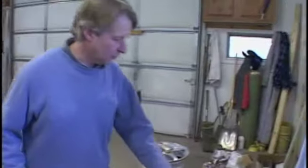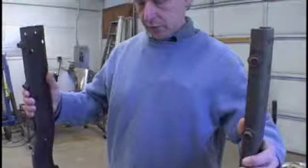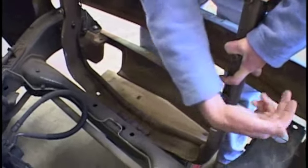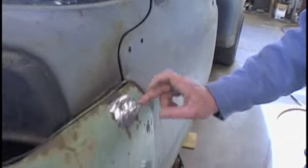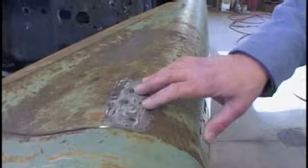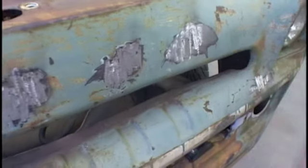The next thing I'm going to have to deal with on the nose is this radiator support. This is the original one out of the '57 — you can see how the radiator bolted here. We can't use the whole thing now that we've mated it to the Dakota frame, so I'll make brackets to come off of here and go onto the front of the frame. It'll also hold the nose in place, which was the original '57 truck concept. There were holes here for script and a hole for an antenna. I want this to be clean up front — no chrome — so I filled those holes in and ground them off.